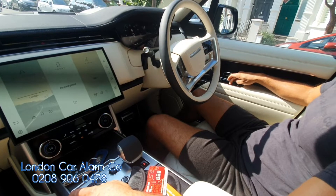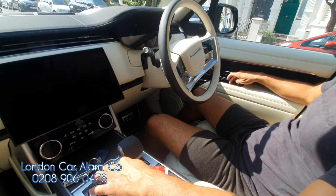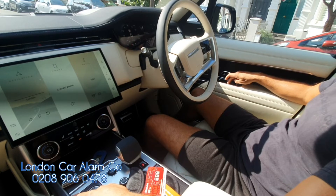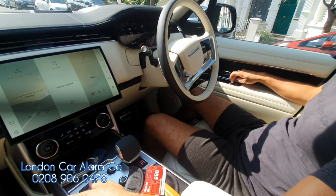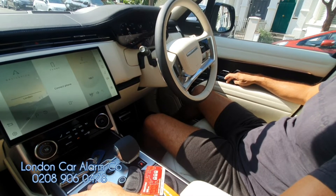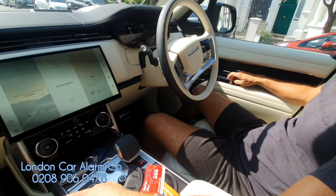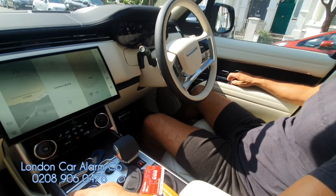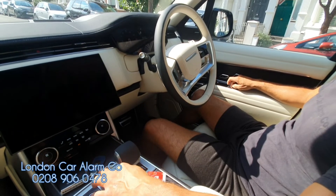So one, two, three, four, five — start button off, then back on. Notice I'm doing the button slowly with a pause and then doing one slight lift rather than a full lift, because the timing is quite critical on this. So I'm going to change the code: one, two, three, four — wait for a double bleep to confirm the code and then repeat again. Notice there was a slight pause in the bleep, so we're just waiting for confirmation of the same code.